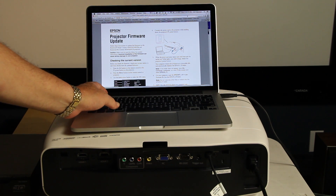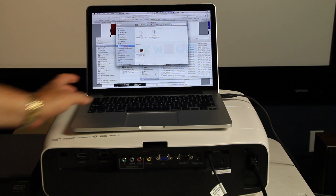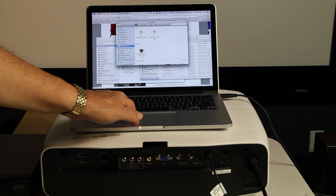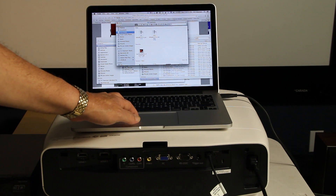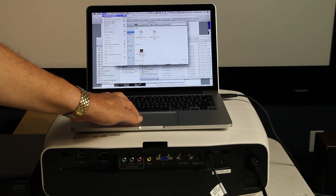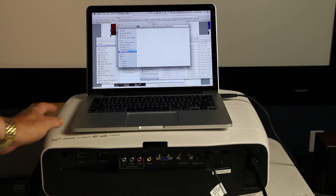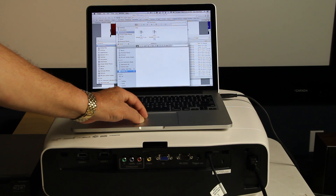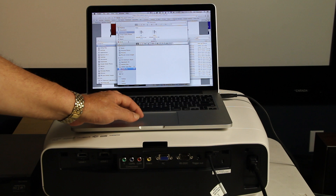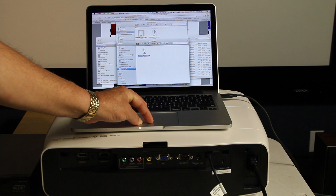Next I'm going to go back to our Finder. It's telling me that we should now see the Epson as another device on the system, and sure enough, here it is right here. I'm going to open up a separate window here just for simplicity, and on this window we're going to select the Epson PJ. What we see here is a blank folder. The next step is to copy the file they instruct you to copy, which is the one that ends in .bin — not the one that has something after that — and just drag this down into the Epson.